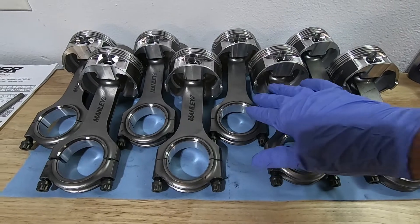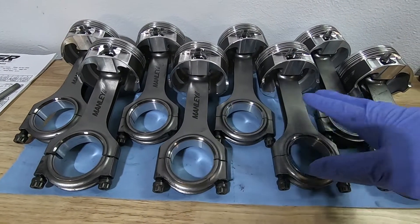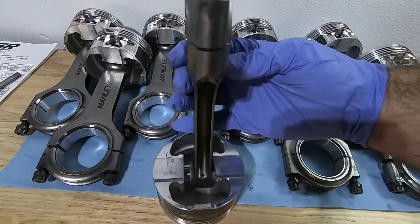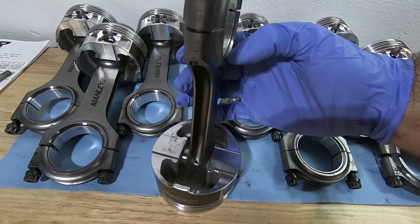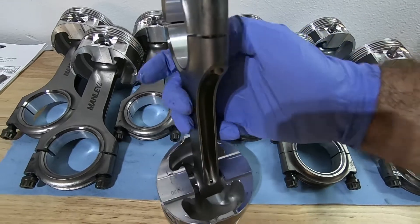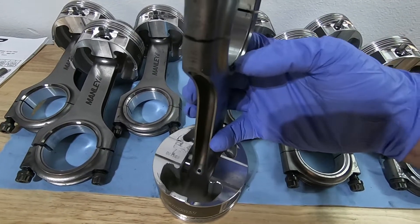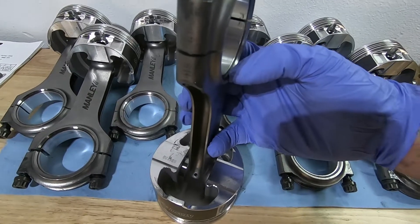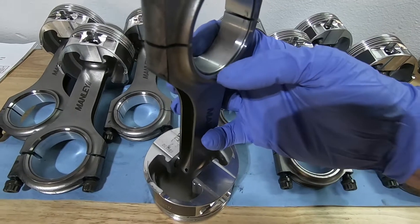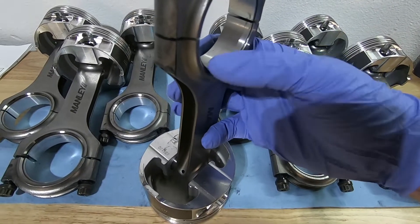I'm kind of glad this happened so I get a chance to talk about the bearings. If it's confusing, just make sure that if the bearing is offset inside the rod — if you see a little bit more material on this side of the rod than this side sticking out from the bearing — then you want that side up against the fillet of the crankshaft. Sometimes that's actually tapered too, or if you get too long of bearings you may have to taper these out. A machine shop can do that.